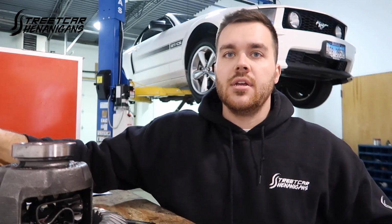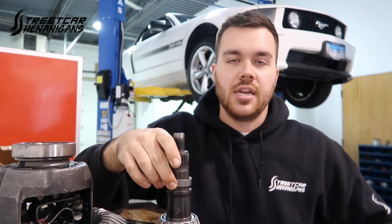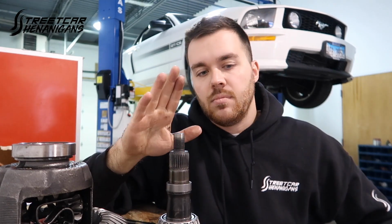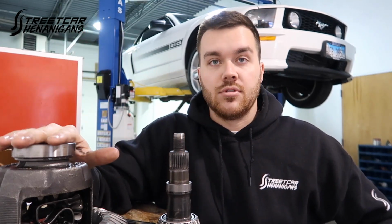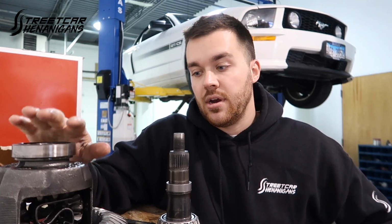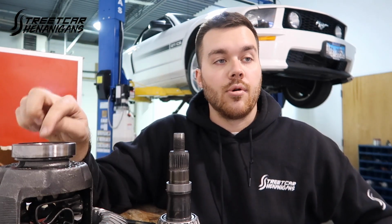For the rest of this video, maybe I'll show you guys putting it in, but that's what we're doing next. I'm going to install the pinion, set the bearing preload. I probably will take it in and out once or twice to try to get the shimming correct on this, and then that'll be it. Then we'll mess with the carrier. I'll show you guys setting the backlash on this so I can make myself happy there. We'll check the pattern. I hope it looks better than it did last weekend. And, oh, one more thing we gotta do to this thing.